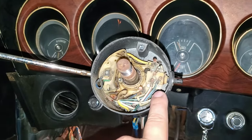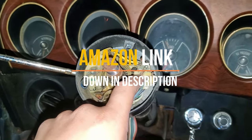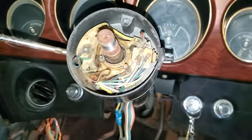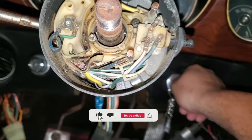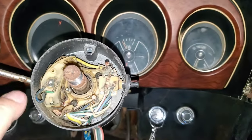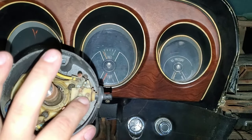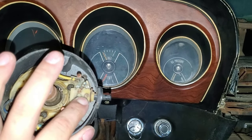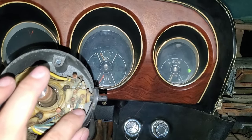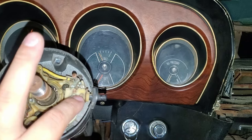Moving on to my problem — what it ended up being is a crack in this hazard light switch that is internally damaged, causing intermittent failure to my turn signals. Let me demonstrate: I'm going to turn the key on and try to replicate the problem. Got my turn signals on — see, they're working right now. See, they just stopped working. Now I'm going to let go — it wants to work, there you go, it's coming back. Now I'm going to push on this again — now it's not working.